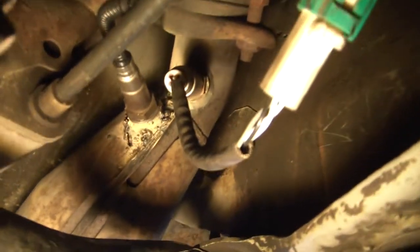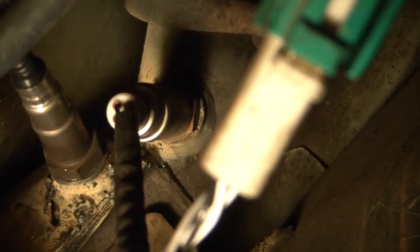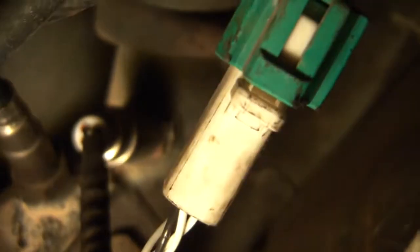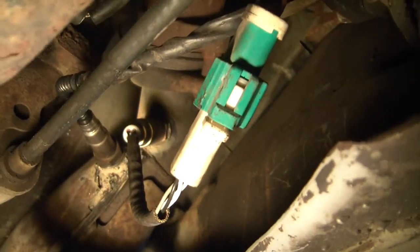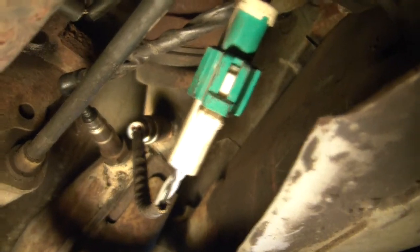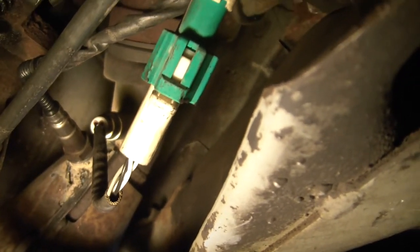I'm using a camera I haven't used in a while. See that ugliness? It's not that bad, but I'm thinking there might be a pinhole leak somewhere in that mess because I'm not getting any reading at idle or at cruise, but I'm getting my reading once I get on the throttle. Of course, you've got a lot more gas pressure going through high loads. If you have an air pinhole leak, it can suck in air, so that will definitely throw off the reading.